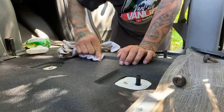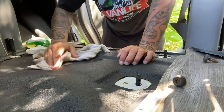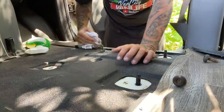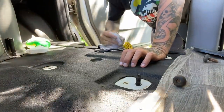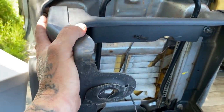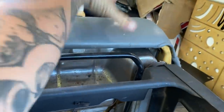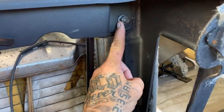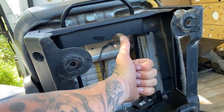I think I'm going to make this a part of my big annual or every six month thorough clean. This part is the stationary base that came with the van — this is what we're going to be removing and mounting the seat to the new swivel bracket. This is just held on right here by four bolts, at least as far as I can see right now, so we're going to pull all four and see if it comes loose.